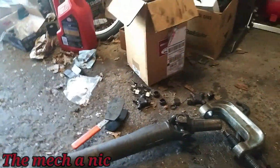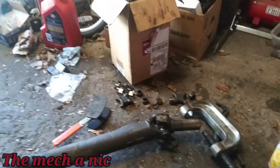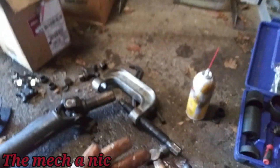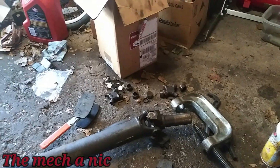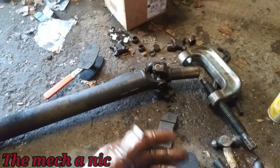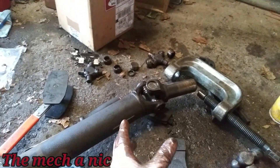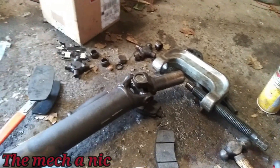One side is just about done and it was a real pain in the butt. Believe it or not, this is the first time I've ever done U-joints. I've always turned down these type of jobs because I just didn't really have the tools — you know, like the press. But the biggest thing here is a ball joint press; that's what really seems to work well. I just don't get too many jobs like this around here. The concept of installing U-joints is pretty simple and straightforward, but it's the little things you have to figure out as you go and learn hands-on.